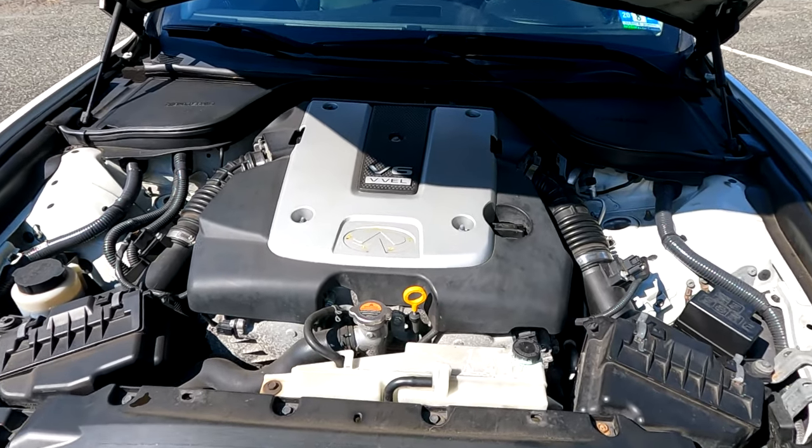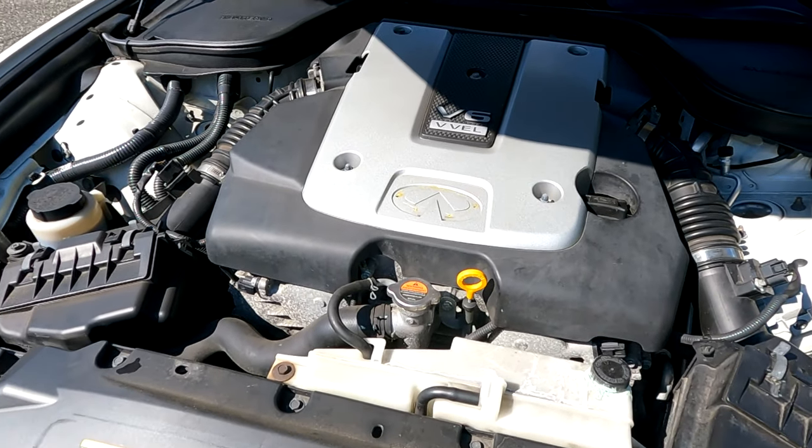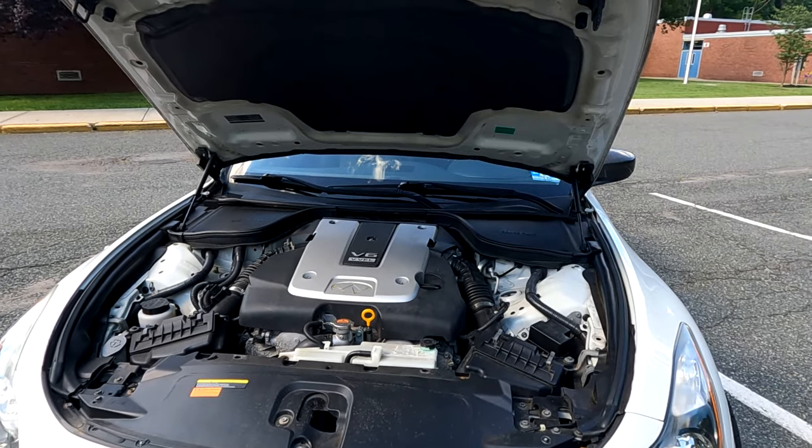When these parts fail, the car will lose a lot of oil pressure, which is detrimental to your engine. Often your car will go into limp mode, but sometimes it doesn't. When you lose oil pressure, your engine goes kaboom — we definitely don't want that. When looking at older G37s and 370Zs, make sure the previous owner did a good job maintaining the car with timely oil changes and didn't abuse it. The good news is that 2013-plus G37s and 370Zs — Nissan fixed this issue.